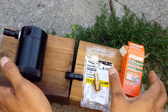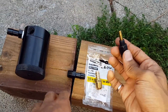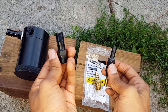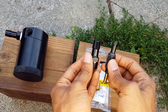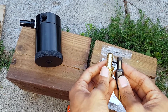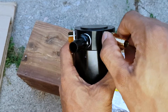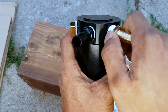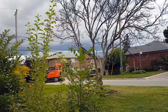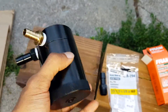Our input is going to be a little different — the input is from our PCV, and if you haven't changed it already, you should. The PCV fitting is a half-inch that comes with the catch can, and this is our 3/8 connector. You want to get a 3/8 barb fitting that's brass as well. We're going to teflon it and install it right there. With the teflon tape on, screw it in and get your wrench to tighten it. And now this side is complete — time to install it.